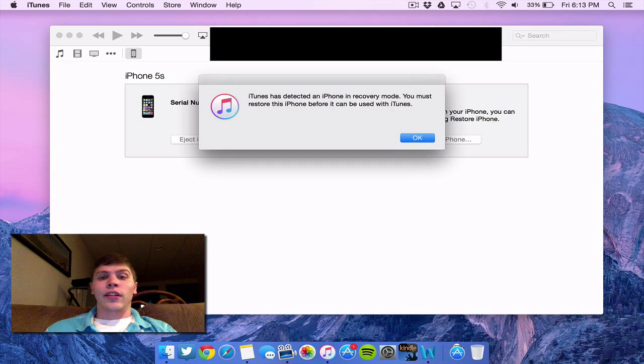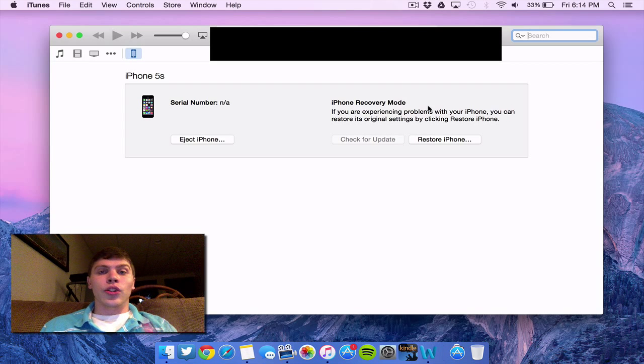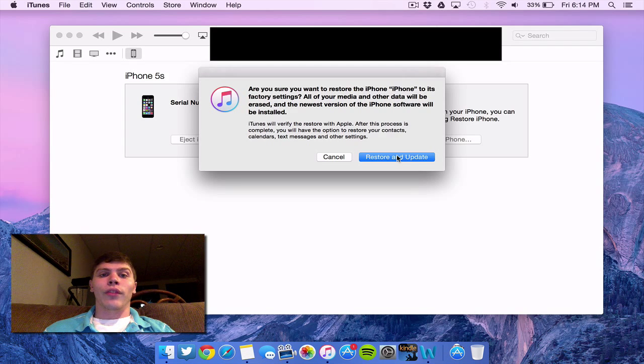As you can see, iTunes has detected that the iPhone is in recovery mode, so I'm going to have to restore it. This will solve 99% of your broken iPhone, iPad, or iPod Touch issues. You're going to go ahead and restore it to factory settings — and if you still have a problem after that, take it to Apple or search the internet for other methods. All you're going to do is hit OK, click Restore iPhone, and then click Restore and Update. This will refresh your whole device and bring all the factory settings back, giving you a clean device. It should fix all issues — all carrier settings, everything.